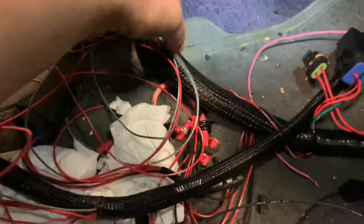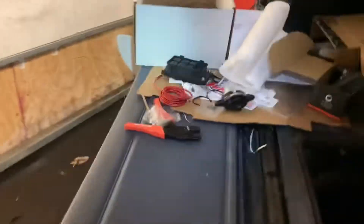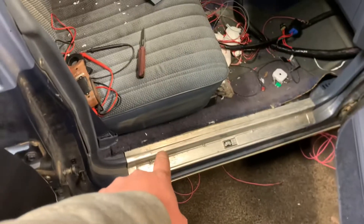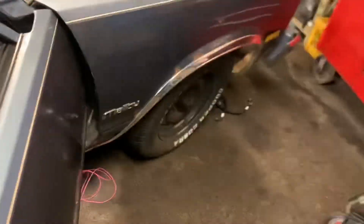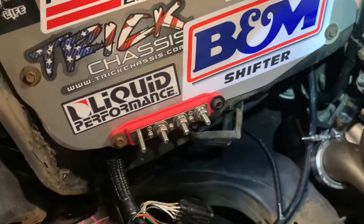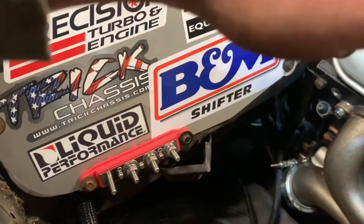Other than that, this is the hard part - all this wiring mess - but it's actually not even that bad. I got the battery where I want to run it, and there's a hole where I run the hot wire up through here into these clips. This side stays above the carpet because there's some weird shield in there. The passenger front side tucks beneath the carpet, comes out the grommet and goes to this bus bar. This bus bar is going to be constant power - one wire to the starter and one to the alternator.